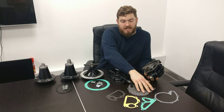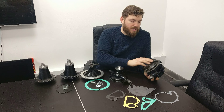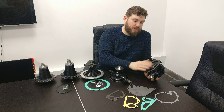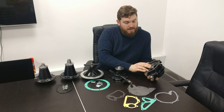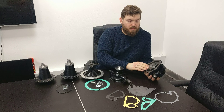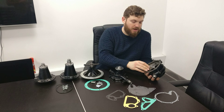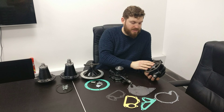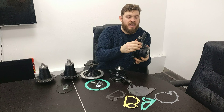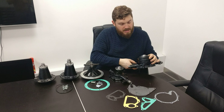All of these bolt onto a back plate. This back plate is available new as well, and it's usually worth replacing because it's in the coolant gallery — coolant running through it all the time. A lot of rust can develop; you get these pitted all the way through and rusty. That then bolts onto an adapter, which then bolts onto the block or the head. These are the gaskets that you'll need to change the water pump.